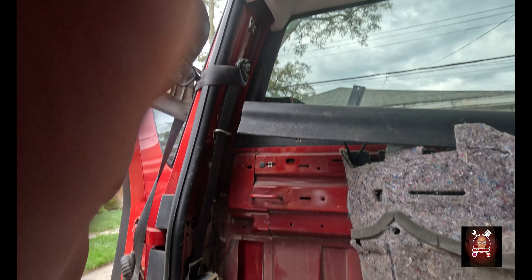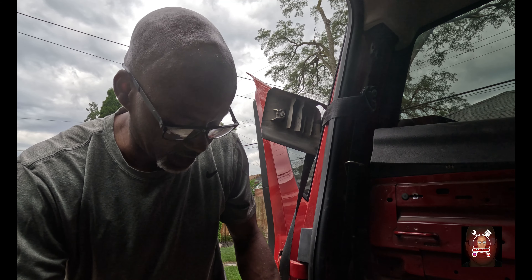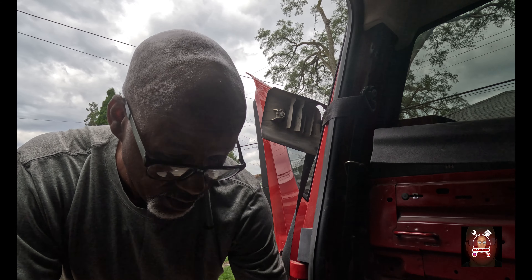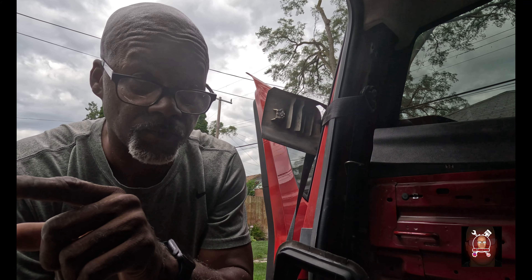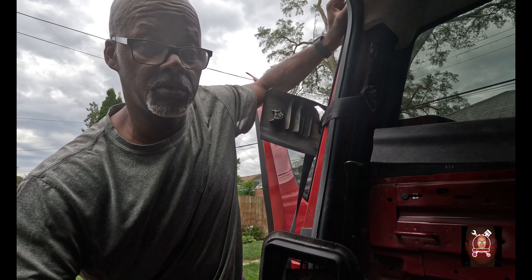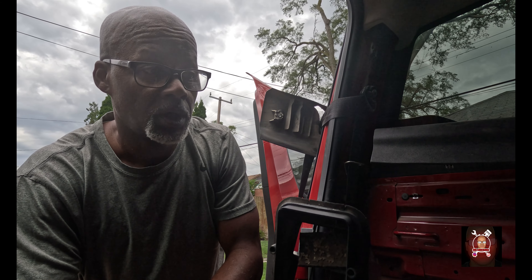What's amazing is I found this out after paying seven hundred dollars for new door seals and rubber and all that. I'd been searching forever on YouTube for what could cause the leaks — it could be the emergency cable, the extended cab seals up top where there's a hole for a pin, the rear window, or the third brake light. I did the third brake light and I did the seals and it didn't stop.